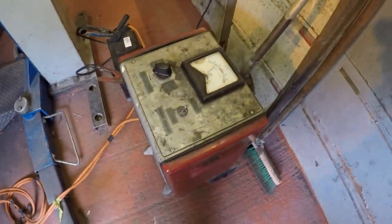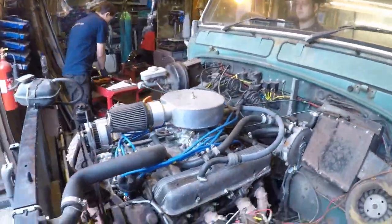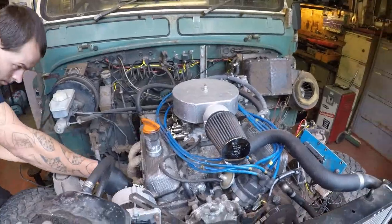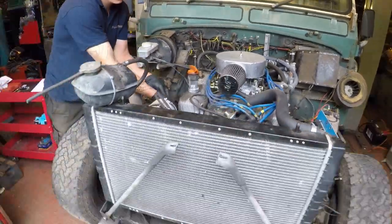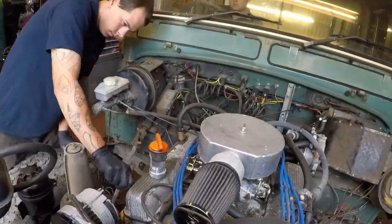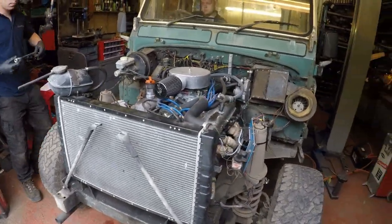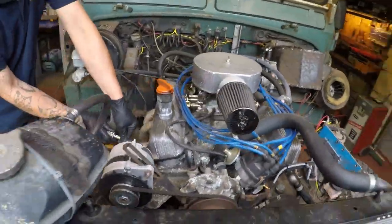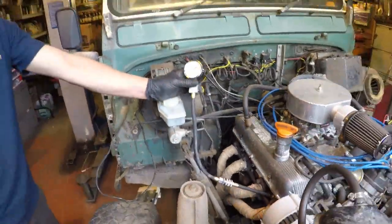Get yourself plugged into a bigger battery with some nice leads, stick on a battery charger, and you should be good to go. We've got Zach in the cab with a clock on his lap so we can time how long we turn it over — trying to count the cranks is difficult. We're going to crank over for seven seconds at a time, nice and easy. The reason we don't just crank continuously is because eventually it will reach pressure but it's not a true reading. If we crank for seven seconds and one cylinder gets 250 and another gets 110, that tells you the real difference. So we take one spark plug out, put the gauge in, and give it a go.